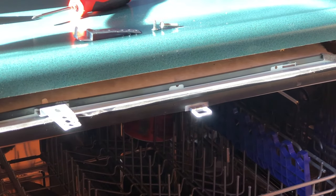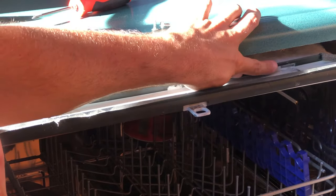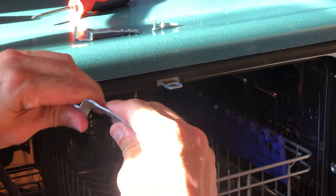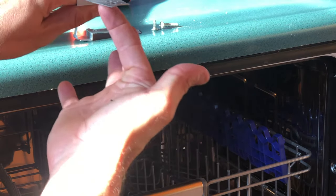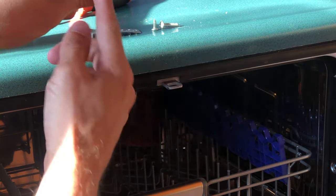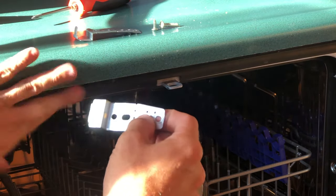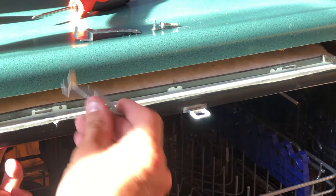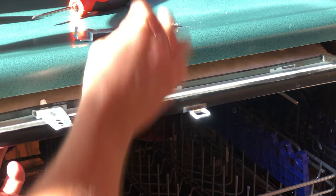Now that we've revealed the top of the dishwasher you can see exactly how these fit into place. There are two slots on the left and right. You want your bracket to look like this — once it goes in here it's going to fit into your slot like this, and then the tang of the bracket is going to stick out. You might have a shorter bracket if it's a shallower mounted dishwasher, but they should all be relatively the same. What we're going to do is slide it in and down so that it sits in the channel just like so.